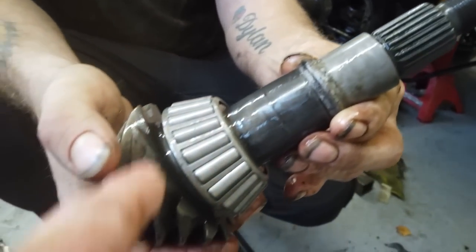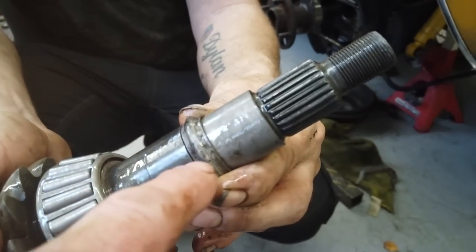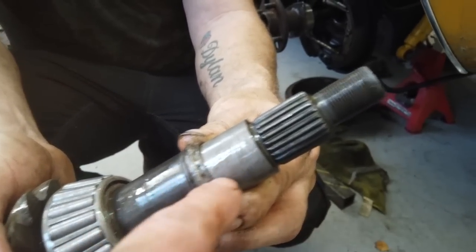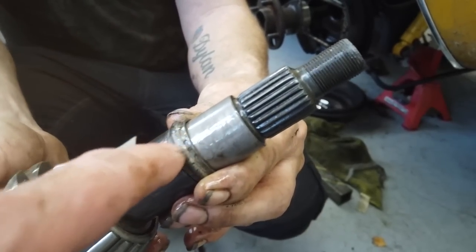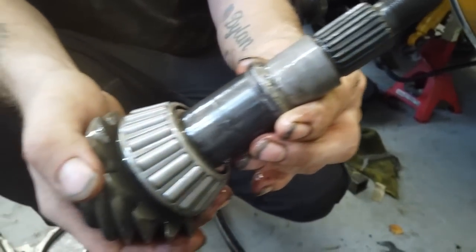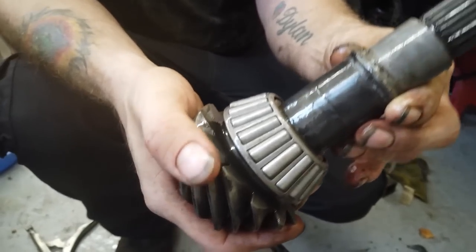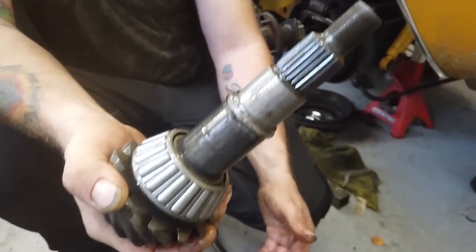We're hoping, because these are the same pair going back into the original axle, that this crush setting is okay, and we're just going to go up till we hit about 71 to 80 pounds on the torque wrench on the pinion nut, and that should bring it back to where we disassembled it. Assuming that they assembled it correctly, we should be back to where we were, although there could be rogue elements that creep in, and we don't know because we're not axle builders.